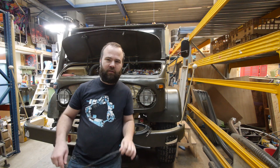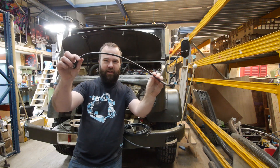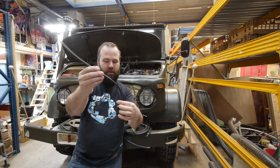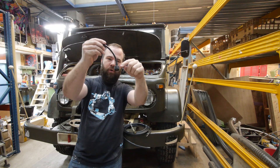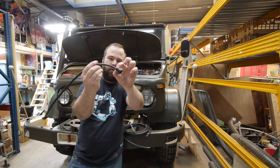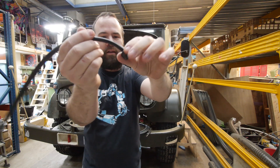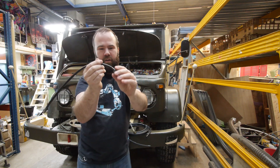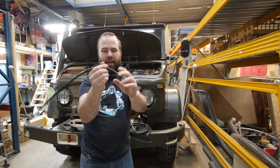What I found out is that these fuel lines are really old and crappy, and the hoses are completely damaged. This connector on the hand fuel pump was leaking, but not on the hose part — on the part here where it can twist. This was completely rusted. I already cleaned it, applied some paint, and dried it out, but it's still leaking.